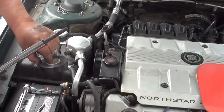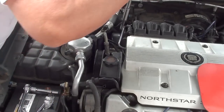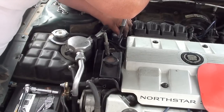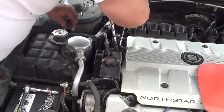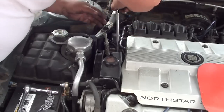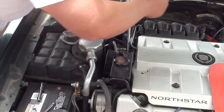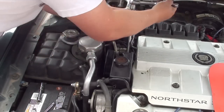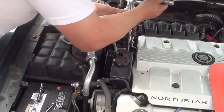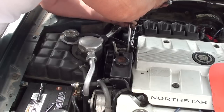I was putting some electrical tape on the bolt head so that when I put in the socket, the bolt doesn't slip out, because the bolt is a little heavy. Put enough electrical tape so it won't fall out. When you tighten the bolt, don't tighten it too tight — remember that you're tightening into an aluminum block. Don't tighten it too tight or you'll strip the threads, and then you're going to have a lot of work on your hands.